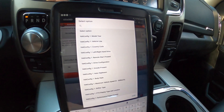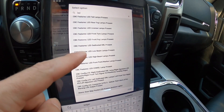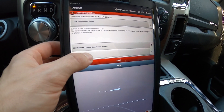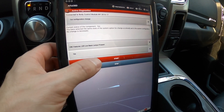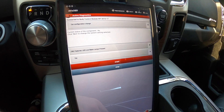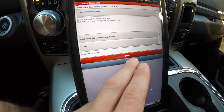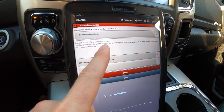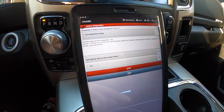Next, go to the search bar and type in 'LED.' You'll see CBC features: LED low beam lamps present. Select value — CBC features, LED low beam lamps present — and change it to yes. Current status is no, click next. Procedure completed. You can hit start again to double check: current status of the component is yes. You have selected the same state already set in the system configuration, so no change is necessary.